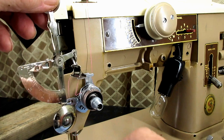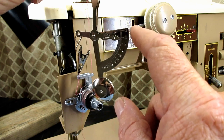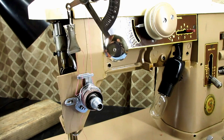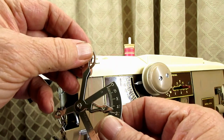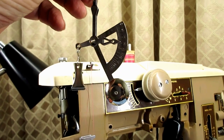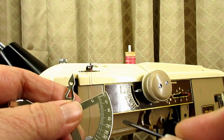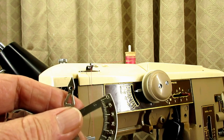I used the old one for years, then got curious and bought this one for $6.95. With my presser foot down, so I've got that little bit of drag at zero, I'm going to clip this on the thread here and look at the side of the meter that reads in grams. As I start pulling this up it's going to move the arrow. It's pretty steady staying right there — that's at 10 or 11 grams, which is right in the 5 to 15 range. I'm pretty happy with that.